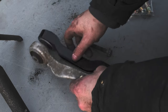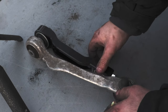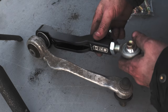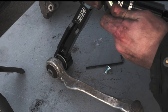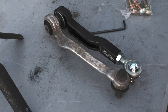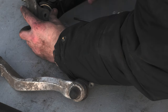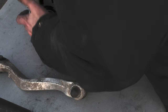These have a similar bushing up top, but down where it connects to the spindle, we have to build it a little bit more. They have a heim joint and a little metal piece with a spacer that goes into the bottom. You're then able to screw it in from the top so it stays in place — it's a very cool and satisfying design to assemble. Quality machine work is very satisfying. The heim joints you can torque down now. The rubber bushings on the top, however, we're going to torque down when the suspension is in the car at ride height, so I'm just getting them loosely in. Once this one was ready, I reinserted it into the upper and went ahead and did the same thing to the other side.